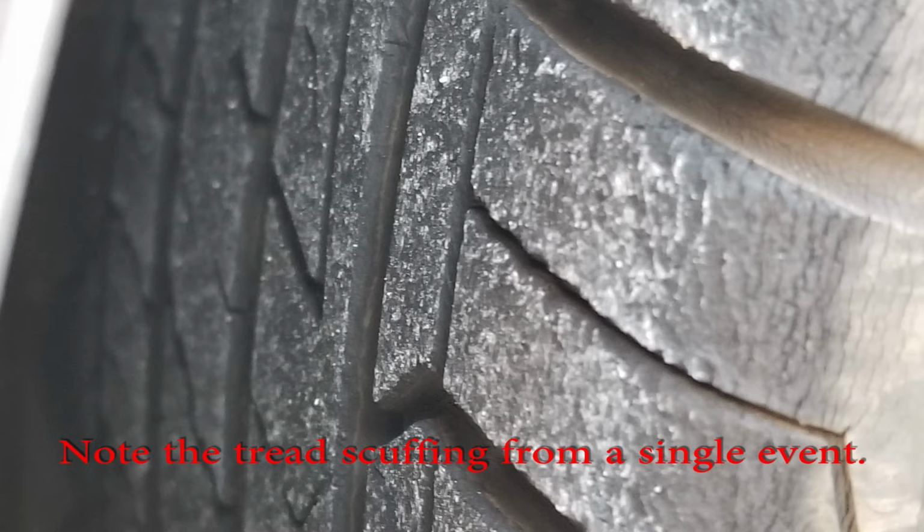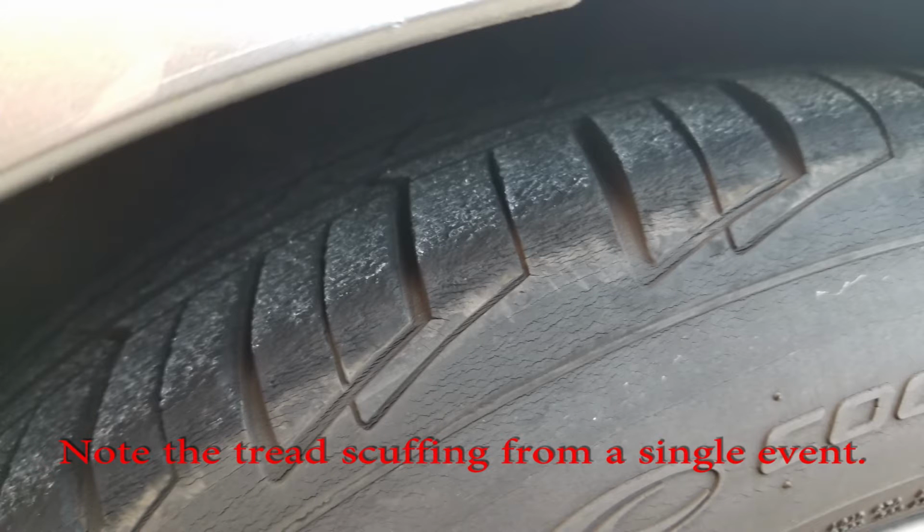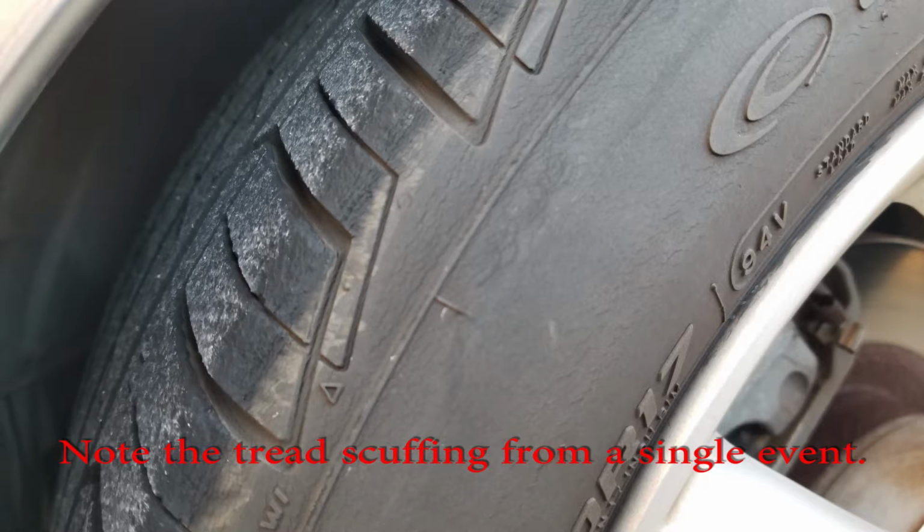The next thing is your tires. Your tires need to be structurally sound, and they need to be properly inflated. Now, for autocross use, you're going to inflate above the recommended street pressures for the tire, and that has to do with the contact patch and the high lateral loads caused by autocrossing, and making sure that you are driving on your tires and not on your sidewalls. And we'll talk more about that later.